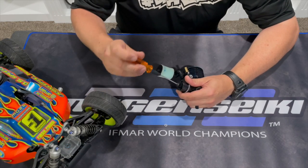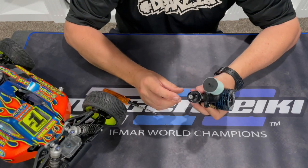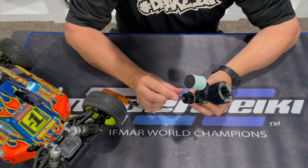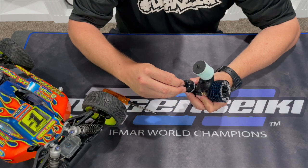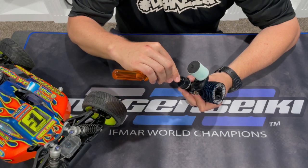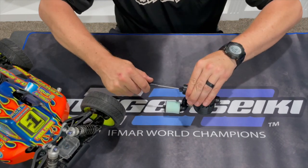If it's too tight, when you tighten down this screw, it will actually crush the bearings. It'll put kind of a side load on the bearings, and that extra force is going to create more drag, more heat, more chance of flaming out at idle, and just all around cause some headaches.